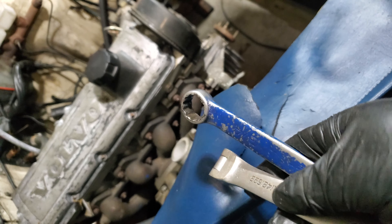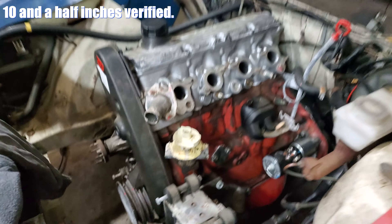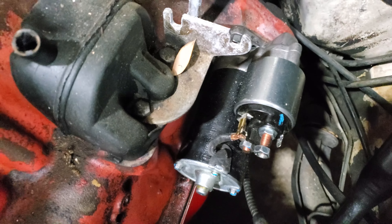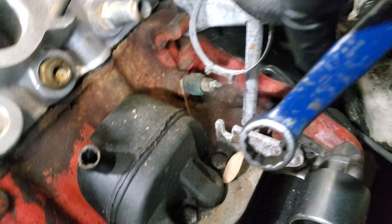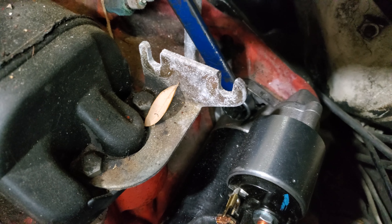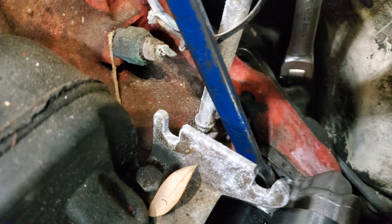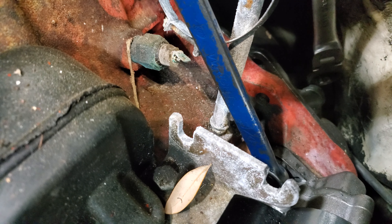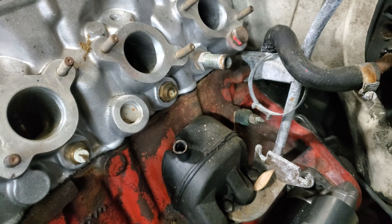These two are your guys — a three-quarter inch and a 19-millimeter, same size basically. I built a little platform, about eight inches to a foot high, so I can get up here when the car's on a jack stand and deal with these bolts. With the starter, the bottom was easy — I could pull the cable off for the clutch. Over here I'd lay the wrench up against the head on that nut, then use this guy to go back here, ratchet it — it's a two-hand deal. Left hand ratchets, right hand holds it on the bolt. That's the best way to do it in my experience.